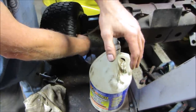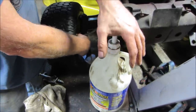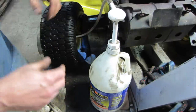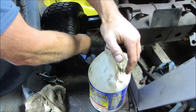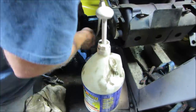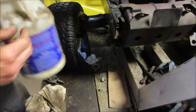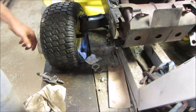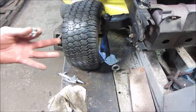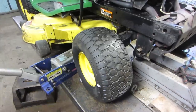What's really nice is if you have the tire off, you can envision in your mind where the stuff is in the tire and move the tire around so it goes over into all those pores. I can get it off. There you go, and done deal. Put that stem in, fill it back up, and as it drives, it'll seal itself. Hopefully. It's just happy it's getting fixed, that's all. Let's fill it back up.